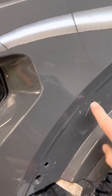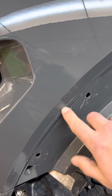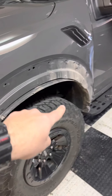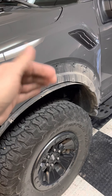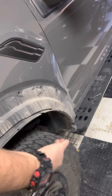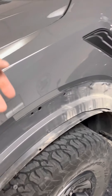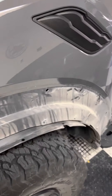You can see there's like this bump here — that's where the foam touches, so that's actually covered up by the plastic. What's easiest is to actually pull the whole deal out if you can stand it. Once you get the back pulled out from around, it kind of hooks under the bottom, and you can start to actually lift it to pull the plastic slots off of these tabs. I think that's the better route to go.